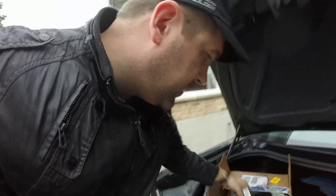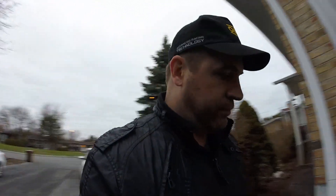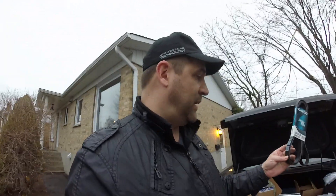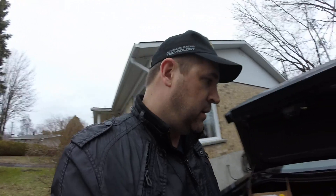There's also one more thing — a new serpentine belt. I was looking at some expensive belts for the engine but that's another debate. The first one is still on after 36,000 miles and it feels a little whiny. I don't want to wait until it breaks, so this is preventive maintenance — get a new one and keep the old one as a spare.